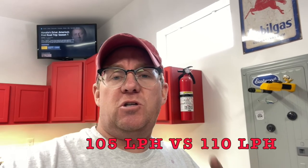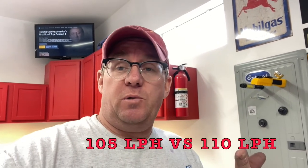All right, you guys, we're gonna call it a day. So to summarize things up, we walked through the fuel pump, checked to make sure they had the right output volume. I'll double check that and throw that in the edit notes when I go through and edit it, to make sure the volume is correct. We had fuel pressure. We know they had really good fuel pressure, over 100 pounds of pressure. Fuel pressure regulator, we're gonna check that once we put everything back on the bike. We checked the fuel injectors. The second injector I didn't get on video because my camera died, so I'm sorry about that. We'll look at the video and see how good that spray is, and kind of determine if that fuel injector needs to be cleaned and sent off, or if it's probably okay.